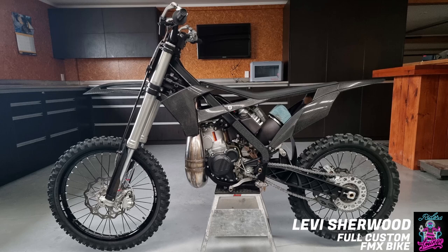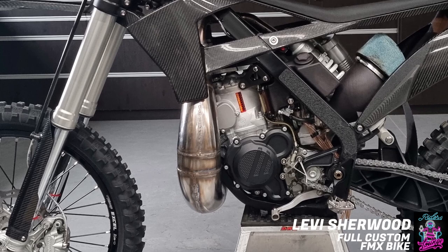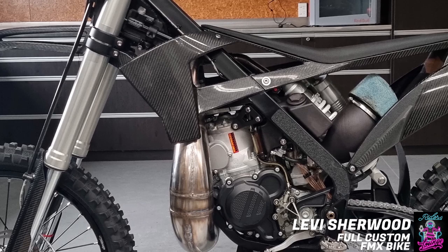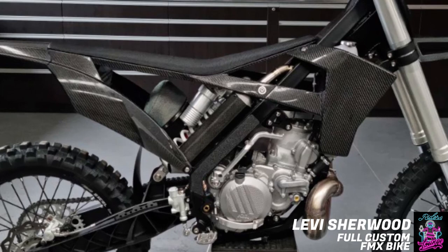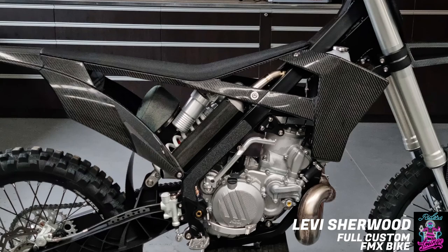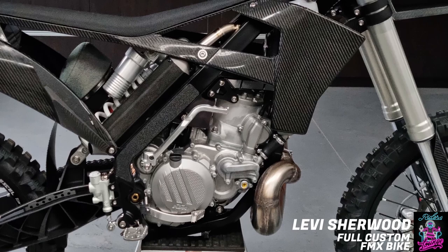Everything's just fine-tuned a little bit from there, not too much to be honest. The exhaust is all custom built — the detail of the exhaust is actually near exact to a stock KTM 250 SX. The muffler is a certain length I've learned that I like over the years. Stock ones are huge — they look like wheelie bars hanging out the back. I prefer the Pro Circuit 304, not the shorty, because KTMs don't really have the over-rev like the jet bike, so I prefer a longer muffler.